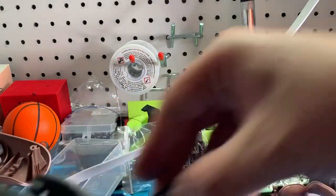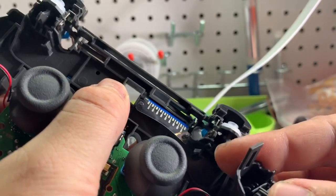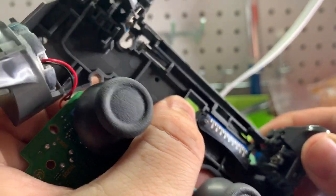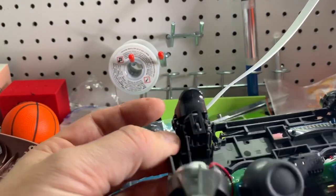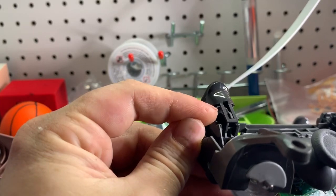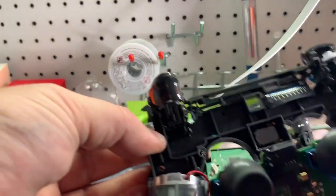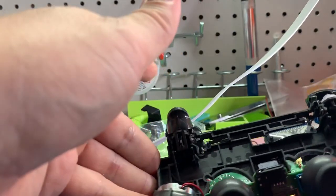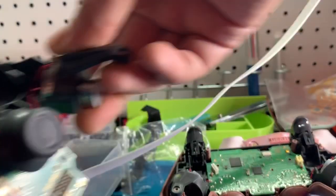We're going to basically be putting our new triggers wired in between those two, making contact with both of them. For triggers normally, there's another conductive pad that has to be depressed downward and that makes contact — you'll see that little black spot there once it's pushed down. The trigger has a spring to return to neutral position and basically a little protrusion that, when normally installed, pushes down on that rubber conductive pad, indicating you want to press the trigger down.